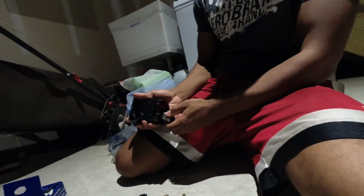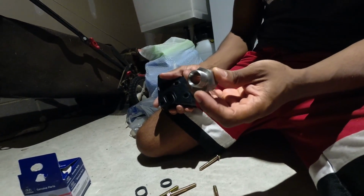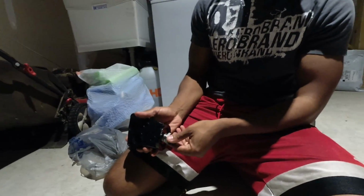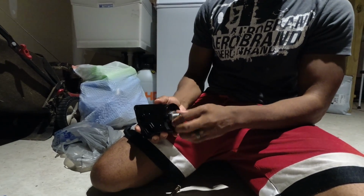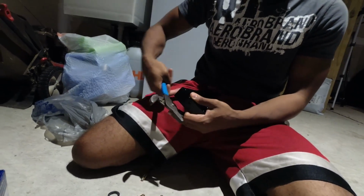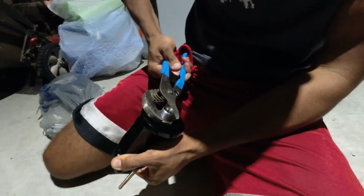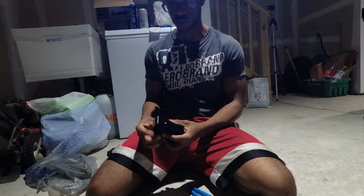And you have right here an M24 to an M20, which is their standard bit here when you're going to your oil filter. M24 to M20 adapter. So go ahead, screw that in. Once you get it hand tight, go ahead and take your channel, adjust it, get it there, and give it a nice good tightening. Once it's nice and tight, you're ready to move on to the next step.